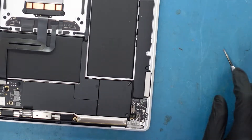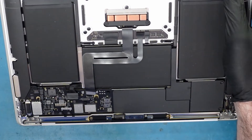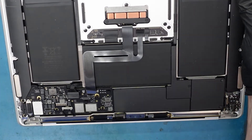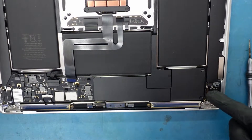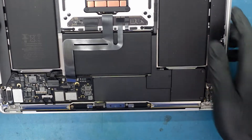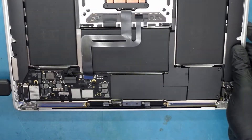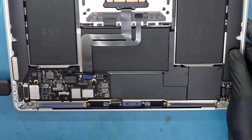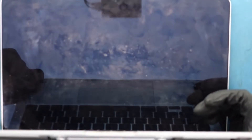That's pretty clean. The only other thing would be the speaker. Let's go ahead and try our voltage again, see if that changes anything. It can, especially if there's a major short or liquid blocking things. This is also an audio board and it does have the speaker connected to it. Let's plug it in, see if it changes anything. Still getting 5 volts — now we're getting more amps and we're getting 20 volts now. We've got 20 volts and 0.04 amps.